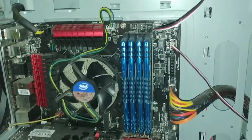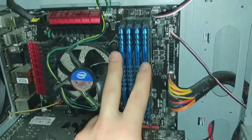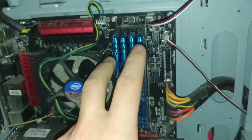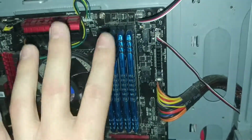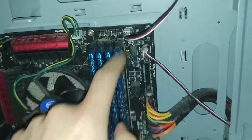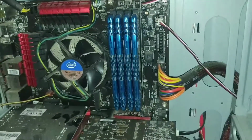So just rip out the 2 slots that you've got. So I know that you have 4 slots total and 2 sticks of RAM. So on the 2 sticks of RAM, you have to loosen the slots up on the tops and the bottoms and pull them out. And on the other 2 slots, make sure you remember to also open up the tab. So just because there wasn't RAM there doesn't mean that they're going to be ready to receive RAM. You have to lift them up and push them back on all 4 of these up on top and all 4 down here. They all have to be opened up and ready to receive RAM, and just click, click, click, all 4 of them. And that's it.